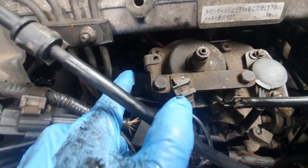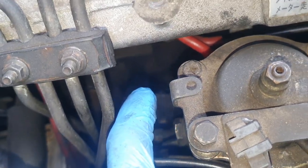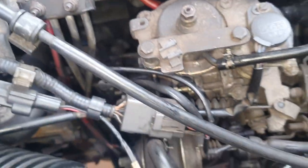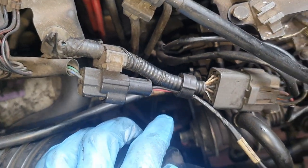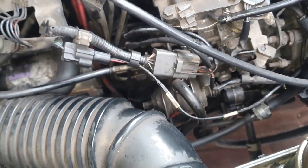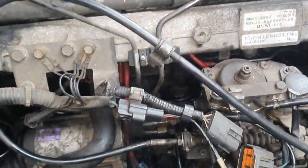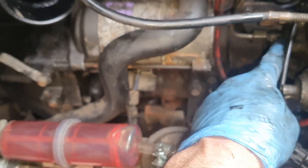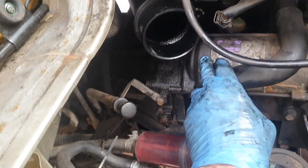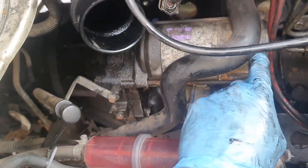You can see this bracket down there. There's a bolt that goes onto the pump on the side here — we're going to slacken that off, and then we're going to get rid of the middle bolt, which is a 12mm. That's the one I showed you on the one in the basement. We put the dial gauge in there and then we get this adjusted. Now, what I've discovered is that my dial gauge doesn't fit in the gap between here and the blooming starter motor. It's two bolts — the starter motor should come off, so I'm going to get onto that.